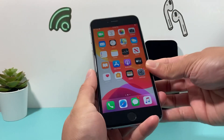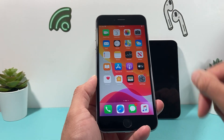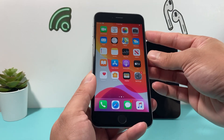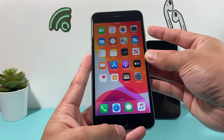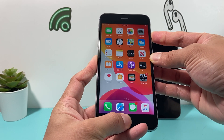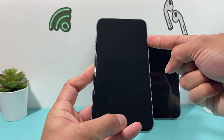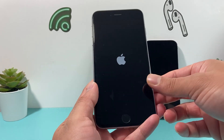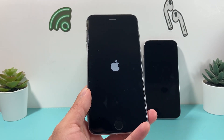Finally, if you have an iPhone 6s or anything older, you're going to follow this method: hold the side button — the power button — and the home button at the same time. So we hold the side button and the home button at the same time if it's frozen or doesn't work. Same thing — press and hold these two buttons until the screen goes black, wait for the Apple logo to reappear, and then let go. That's a forced restart on the iPhone 6s or anything older.